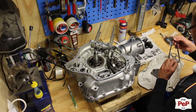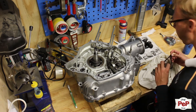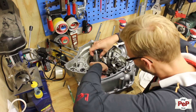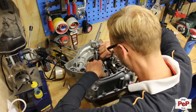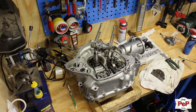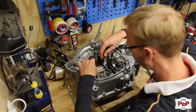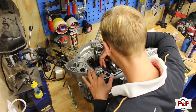Then it was time to install the oil chain and oil sprocket. Before storing these parts I had connected them together with a tie wrap to make sure the chain was in the right way on the sprocket. I cleaned it very well before adding new engine oil on it. I noticed there was quite a bit of slack on the chain, so I tried another combination of sprocket and chain from another engine I have. But that combination had even more slack, so I knew I was working with the right piece and that the slack would be okay.